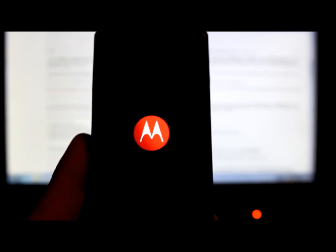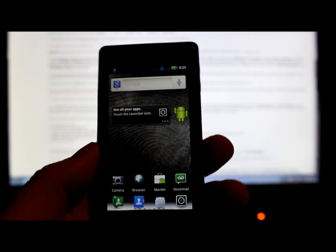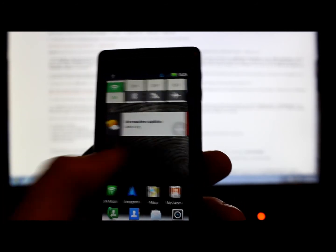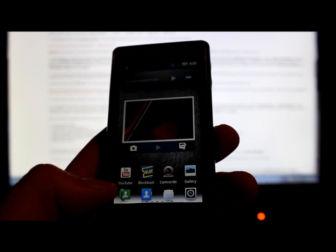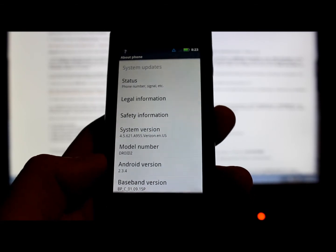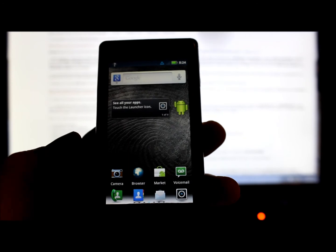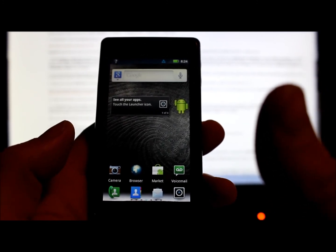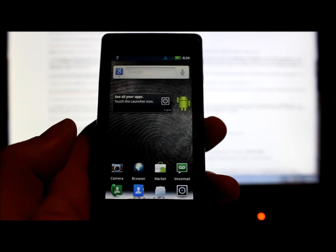This time, if you were boot looping, this should wipe everything and you should be 100% good to go — it should just boot up fine. Here we go — after wiping data, everything booted up fine. You're completely back to full stock, exactly like you'd get it from Verizon. That's it guys — that is how to SBF your phone and factory reset it back to stock. We're on Android 2.3.4. Hope you enjoyed the video — hit the like button, everything's linked in the description, subscribe, and check out rootjunkie.com.